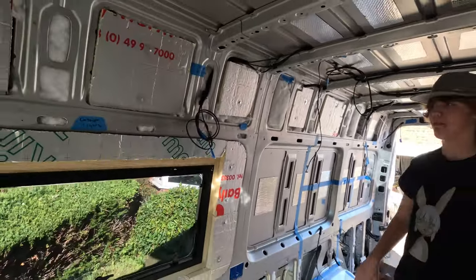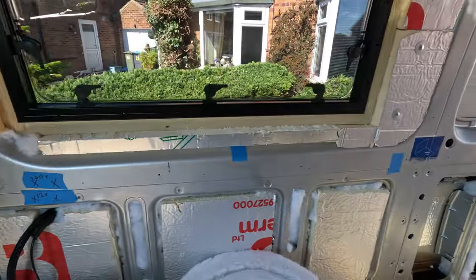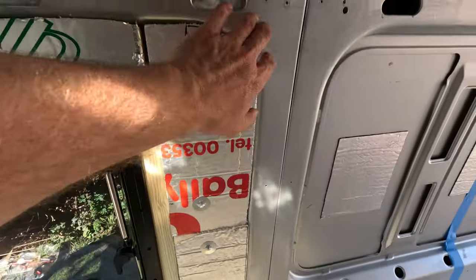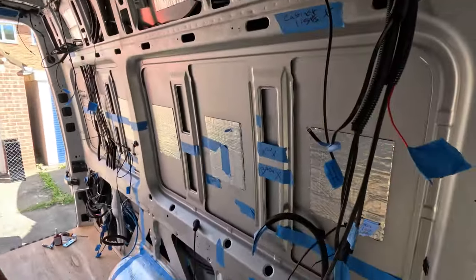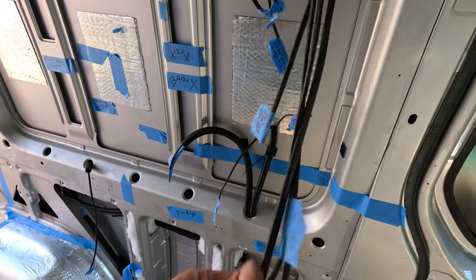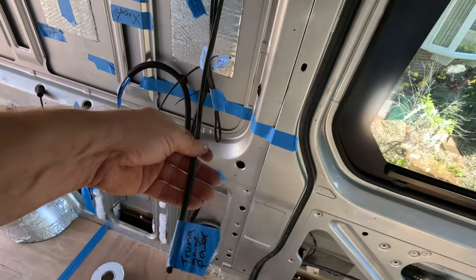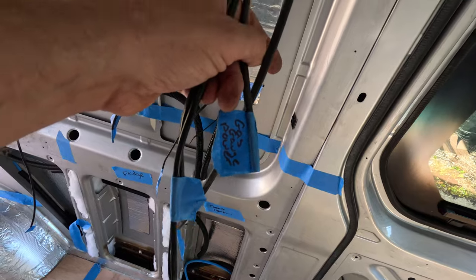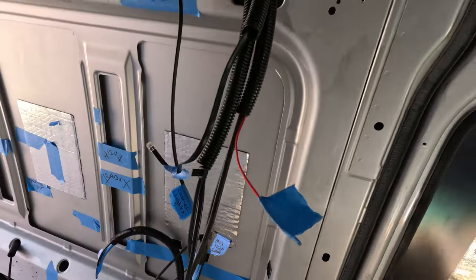John's back from his gaming morning and can show us the insulation progress - beautiful insulation all around this panel, he's got it all inside there, managed to get it all up inside there as well. Fantastic - he's going to move on to the next panel but not today, hanging out with his mate today. I've been doing some more wiring - getting in wires for the Truma boiler display, the controller, and gauges for the gas tank. I've got a sender here which will tell me how much gas is in the tank, and more to add yet for the water tanks.